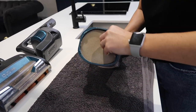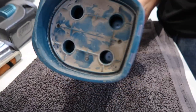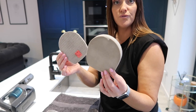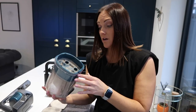There's the first filter and there's the second one. As you can see, they are really dusty and grimy. These are the pre-motor filters and you're not actually meant to use any detergent on these — just warm water. We're going to pop the tank in the sink and give it a real good scrub in the antibacterial water.